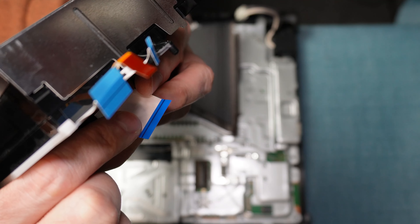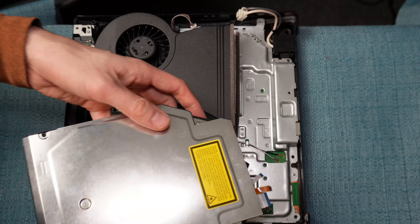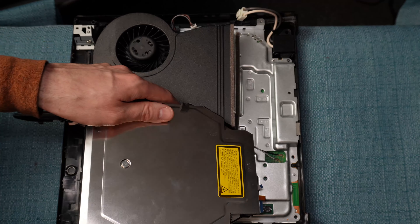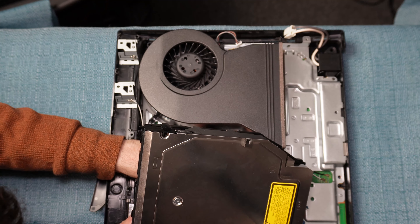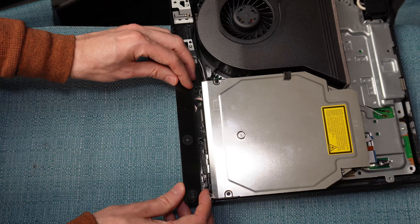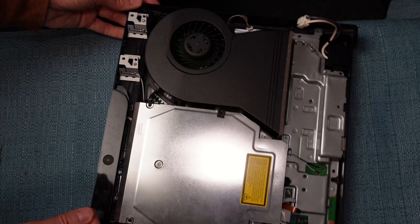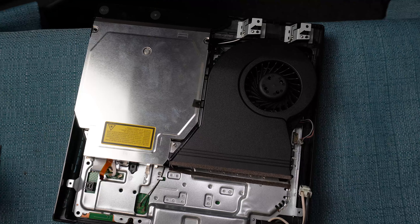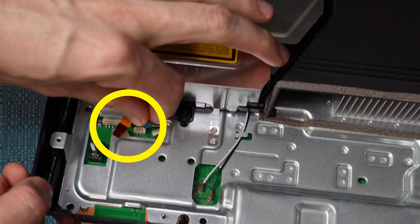If you have a ribbon cable that comes out of the bottom of the CD drive, you will now encounter the hardest part of the whole process. Getting that ribbon reconnected is very tough due to how short it is. I did it by sticking my hand under the drive and using my fingers to put the ribbon into the connector — this took quite a while. You may be able to use needle nose pliers to do the same thing. Place the button panel back into position. Make sure the drive is properly positioned — you should feel it drop into place when you get it just right. Then put the one screw that was holding it back in, then reconnect the three ribbon cables.